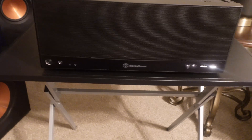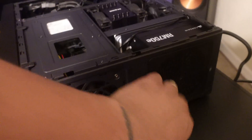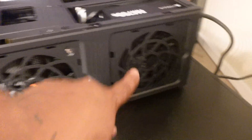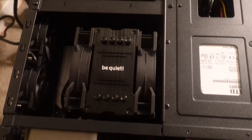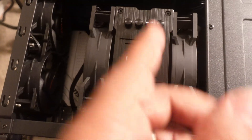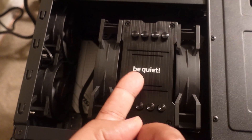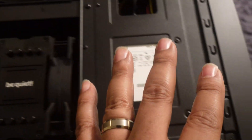Let me show you guys the motherboard. I could not wait to get this thing put together — let's get a look at the G11. Silverstone looks beautiful. I'm going to fit this thing right above my receiver, so it looks like a receiver — pretty much the same width and height as my Denon 970H. We've got a couple of filters here that just pop right off. All these Be Quiet fans — we've got a power supply there. That's a 750 watt Corsair RM750e. We've got the push-pull configuration — the heat rises from the processor, it's being pushed and pulled, and exhausting at the rear.